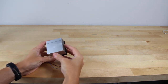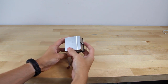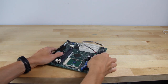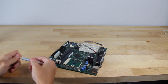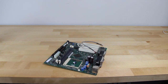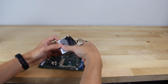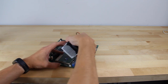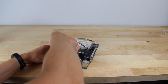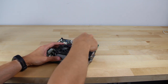After some screwdriver work — sorry for the scratch marks, it's an old machine — it's about as clean as it's going to get. We're going to put a little thermal paste on the processor and reinstall that heatsink. There are many different schools of thought on how to apply this — in my experience it doesn't matter that much, so I usually just put a blob on. Getting this reinstalled — this one was a little tricky to get latched properly. There we go — like a glove again.